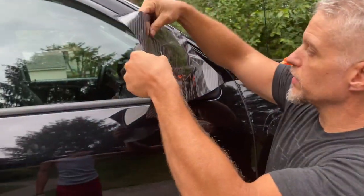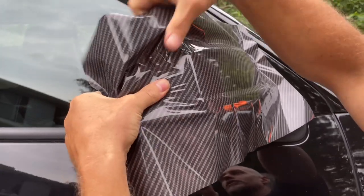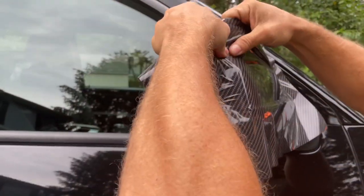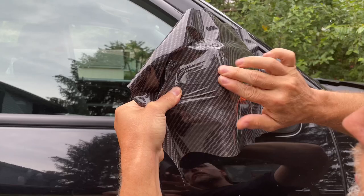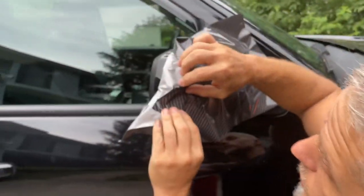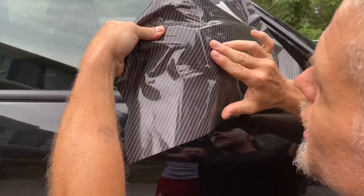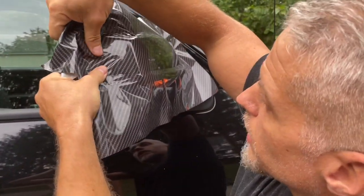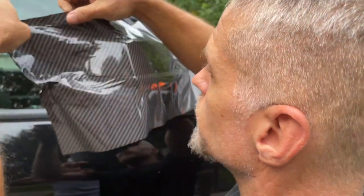What you want to do is take this material. See these little creases, where it's about to wrinkle? Just take it, take your thumbs, and stretch it — see how that's stretching? See where that curve is? Take it and stretch it. See where these curves are? Just take it and stretch it. Take your finger, rub it over top, because it's very forgiving material. If it sticks to itself, it's coming right back off. Take it where the creases are and stretch it — now it's coming out like paint. That's beautiful. Take your thumbs and stretch it, just like that. Make sure you activate the adhesive. Keep stretching it until you've got the top portion done.